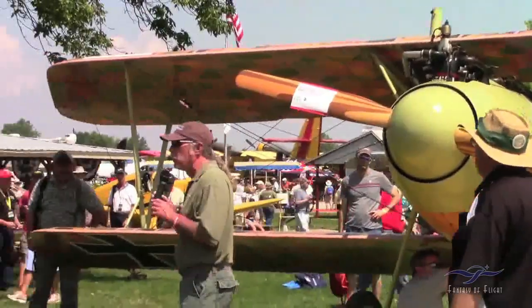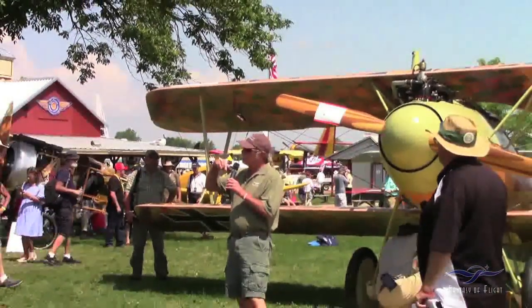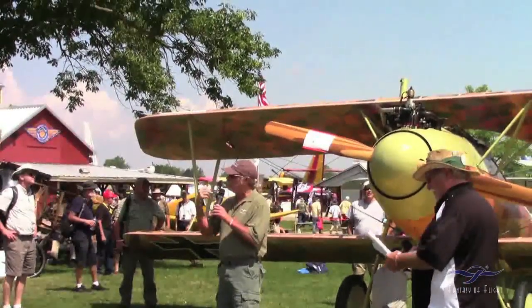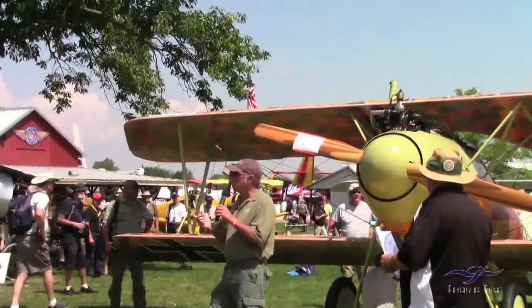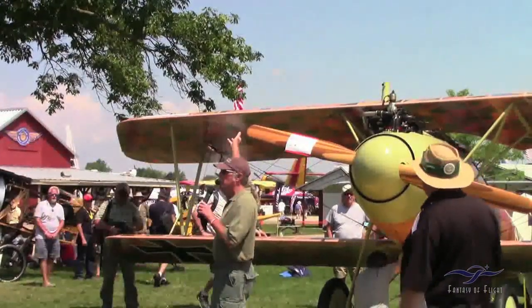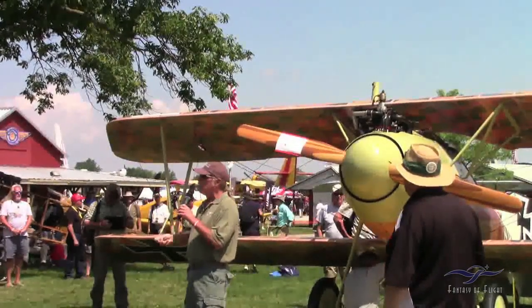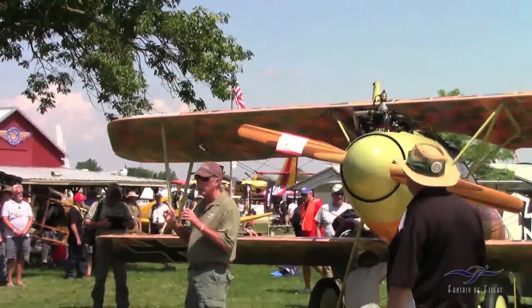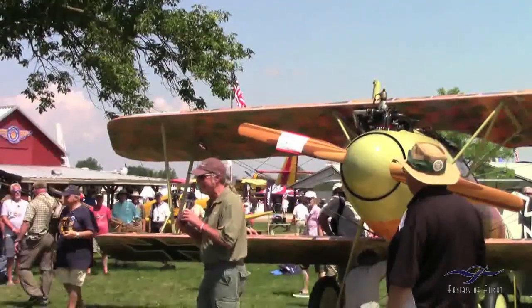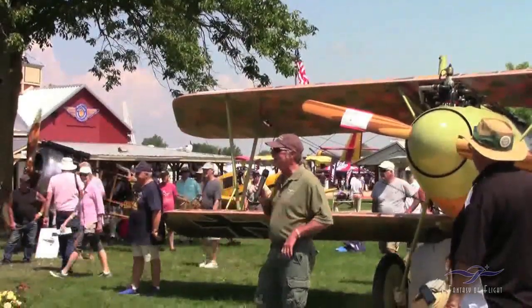The periscope thing on the radiator: you fill it up, and what that little cup does up there is it basically puts pressure on it. But if you have a boil over, that's where it boils out. So it's above the radiator, so it's got a little bit of expansion space for the water. And when they first built it, they put the radiator in the middle of the wing. Guess what? That wasn't a very good idea. So they moved it to the side so it wouldn't get in the pilot's face.